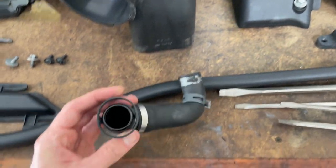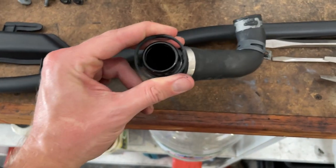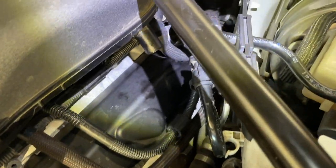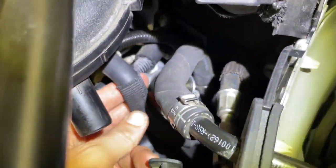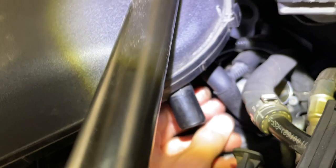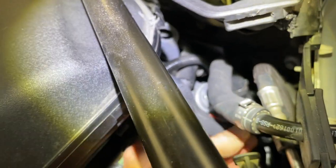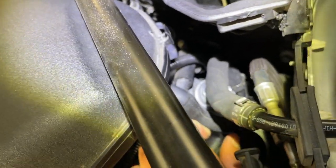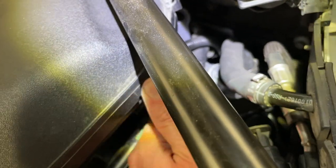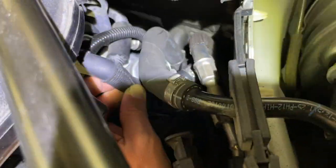For the quick-release connectors, find the open parts, squeeze them together to push the tabs apart, then pull the hose off. There's also an annoying smaller hose that uses an Oetiker clamp attaching to the plenum — it's not easy to remove from the plenum side, so remove it from the cylinder head instead. It's very challenging to get in there, and you're best to lift the plenum up a little bit so the pinch points rotate to allow access.